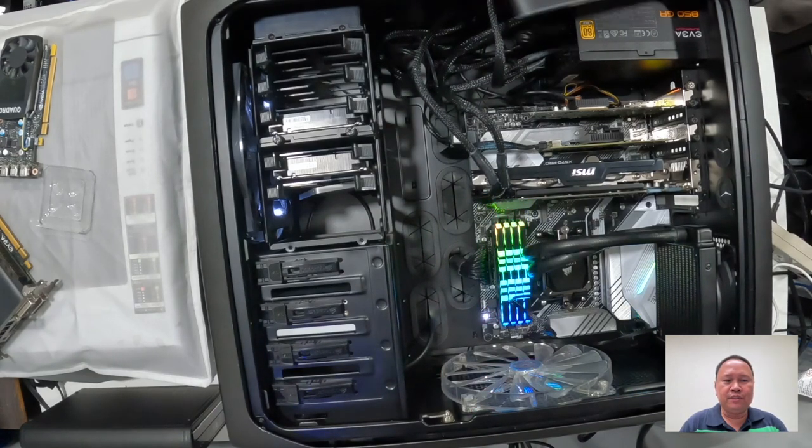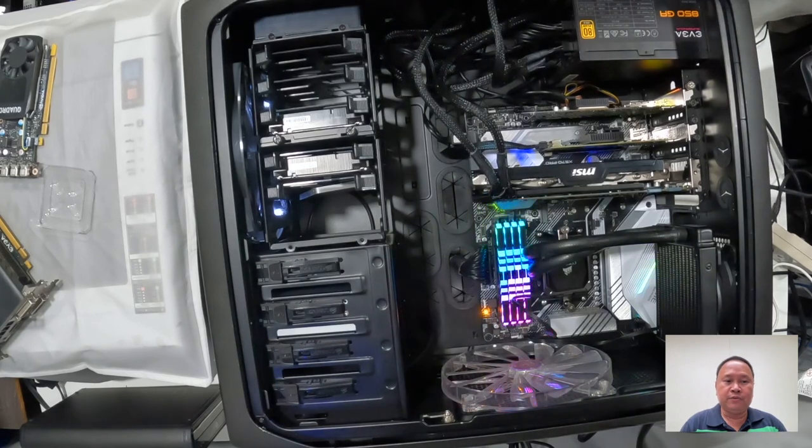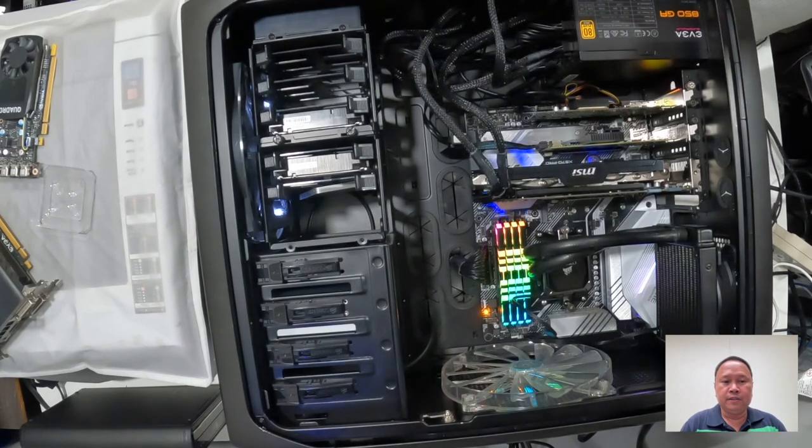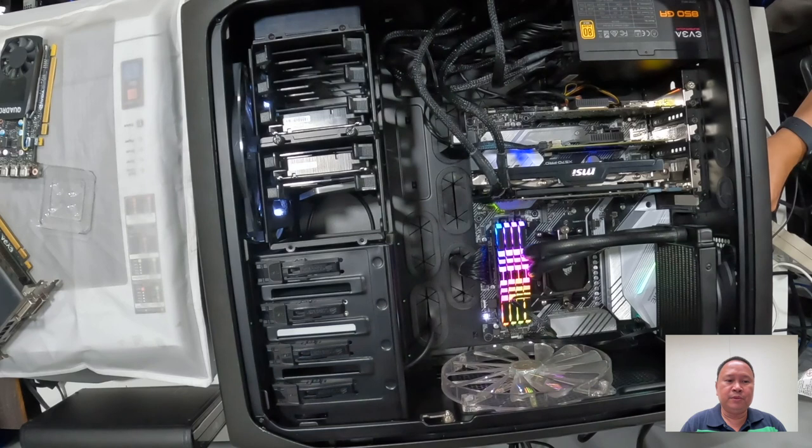It gives the warning of TPM. This warning comes up when it detects a new CPU installed. Remember, this is a refurb motherboard. Also, the warning is for if you use BitLocker to encrypt your data. If it detects a new CPU and you have BitLocker enabled, make sure you disable it before swapping the CPU or the data becomes inaccessible.